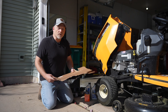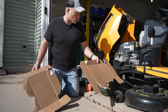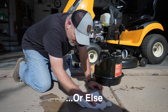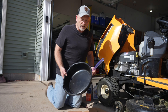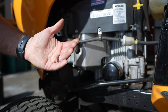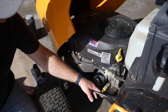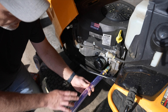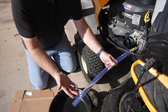The next thing you'll want, if you want to save your garage floor, is some type of protection — I just have a couple of pieces of cardboard. You'll also need a way to collect the oil; a drain pan like this works very well. With the oil drain on this type of engine it's very simple: there's a spigot that has a cap, and you can get an exact size diameter tube to fit over it. I just chose a one-inch diameter tube which lets me get to the drain pan without creating a lot of mess.